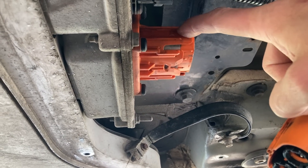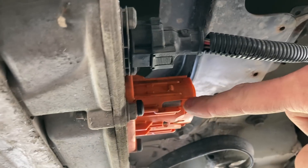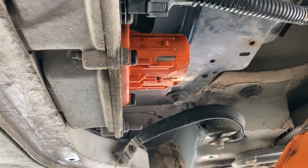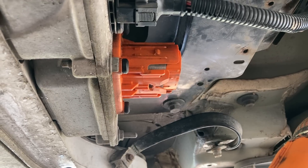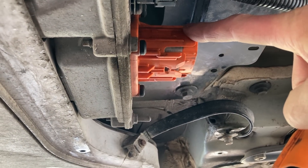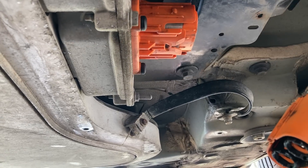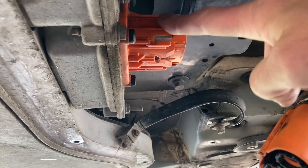This is going to be a bit more fun. I've done a little bit of repairing these connectors before, and they're sort of not one piece. You can see there's a little aluminium shield there, and this inner and outer are actually separate parts — that's like a kind of shield for the inner part. They do come apart, but they're quite tricky — there's little tangs holding different bits in place. So we're going to have to try and repair that. Obviously I don't really want to take the battery out, take the lid off, and have to unbolt the connector inside and take the whole thing off. Ideally we want to try and get this outer part off, but that's going to be interesting — should be possible though.